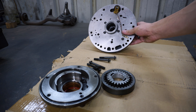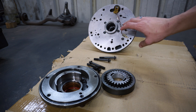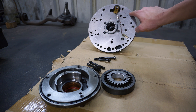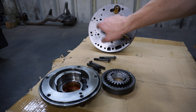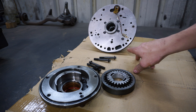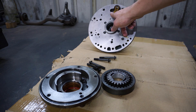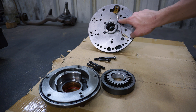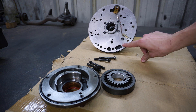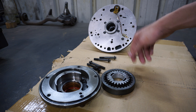So we've got our BA pump cover. I've taken this apart, brake cleaned it, put a new gasket on, cleaned the solenoid and put it back together. These bolts go to 15 Nm and I'll show you the sequence: one, two, three, four, and then five — this last one is unimportant in the sequence but I do it at the end. I recommend you take this apart, replace the gasket and give it a good clean out. Now it's ready for our pump to go on.